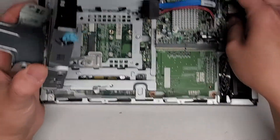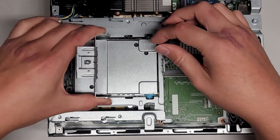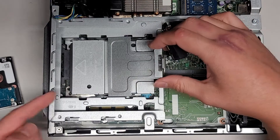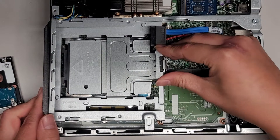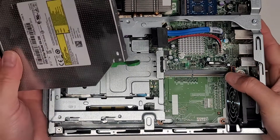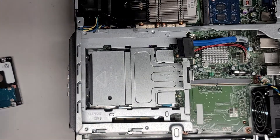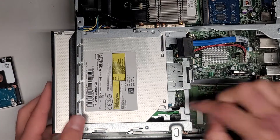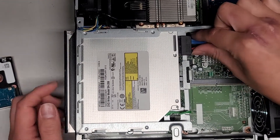Let's go ahead and get this back into place. There are actually these little notches here, so we're going to line that up and drop it into place. Then we're going to close this back down. You can kind of push it to slide it back into place so it connects into that slot there, then click it into place. Very nice and easy to do. Then we'll take the CD drive or optical drive and put that back in. Make sure this green part goes behind this metal, then just push it until it clicks into place. Make sure to plug this back in, of course.